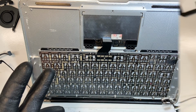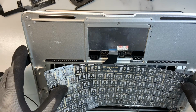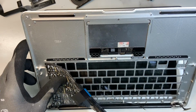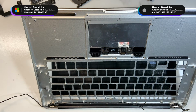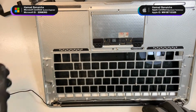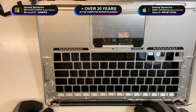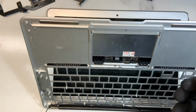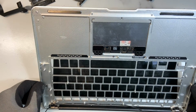Hi guys, I'm back again. So just to recap quickly for things you haven't been able to see off video. I had to tear this keyboard apart like this, using a little bit of force. What I should warn you is you have to be careful not to damage those cables over here, especially that one when you remove the keyboard, for the microphone or the camera. Make sure you're gentle enough. Also be careful not to damage the screen behind. It should come easily if you're just careful. Take your time, don't rush it. And that's pretty much it.